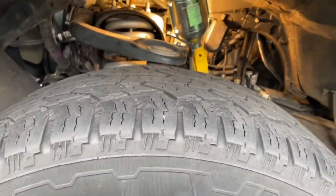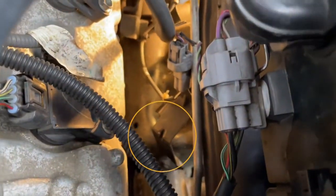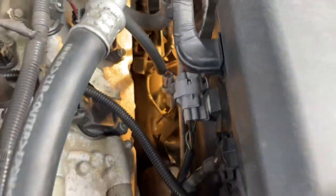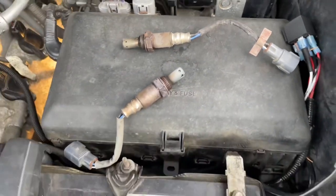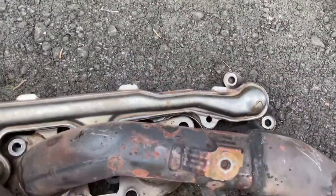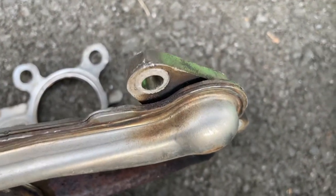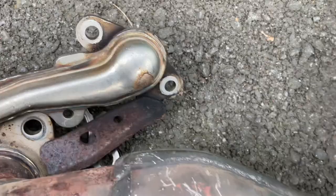In order to pull the manifold out, you're going to want to loosen the bracket for the wheel speed sensor and get it out of the way because the manifold will get hung up on it. I've got my oxygen sensors in there — I took them off the cat-back so that I didn't damage them. Flip this over so you can see why I took it out: the manifold itself is not too bad, but it's leaking right there from the secondary air injection system port — see all that soot on there.